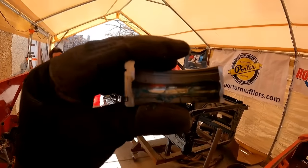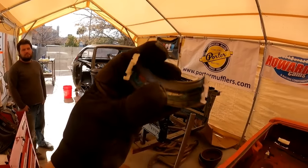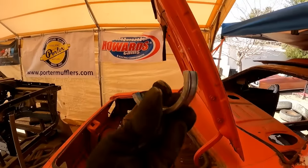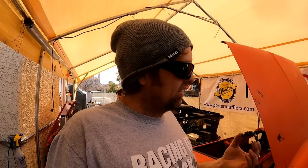This is junk. That is what your car is riding on, that tiny groove with those wide spaced out ball bearings. I mean, look at this. That is a plastic retainer holding those little bitty, itty tiny little balls in place. Yep, so what happens to plastic when it gets hot? Yep, it melts. So then, those balls that are spaced out, well, they start to get tighter, then the balls start touching, then it starts grinding, starts making some noise.